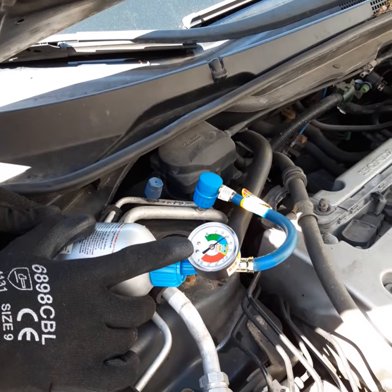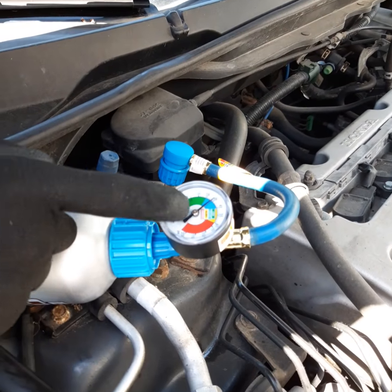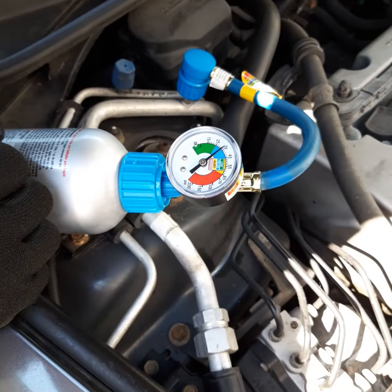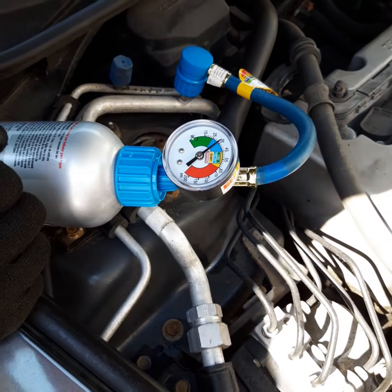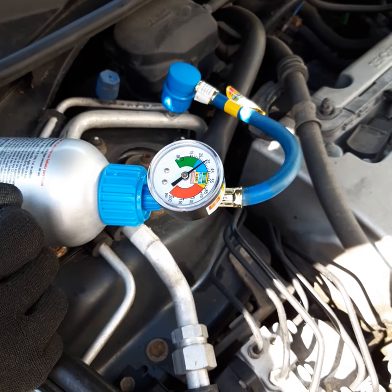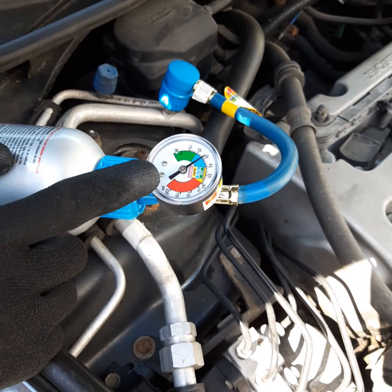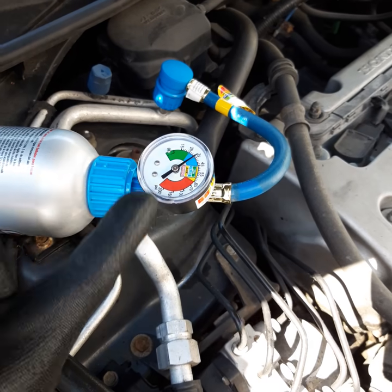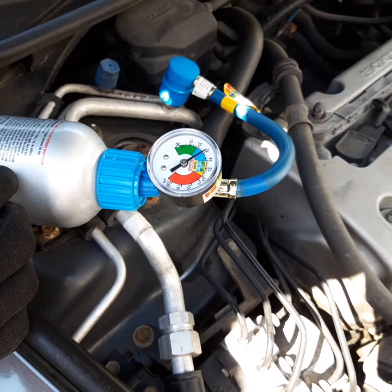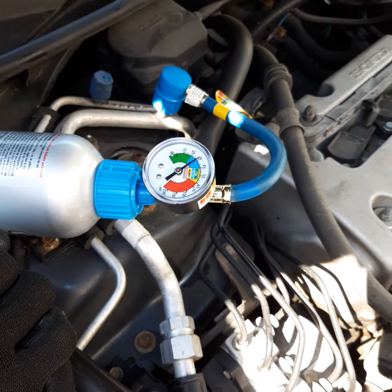By now I've added one and a half cans of refrigerant. You can see the gauge is now at the midpoint of the fill area. I already went and checked — the car is blowing cold air. For under 25 dollars I've recharged the system and will have cold air for the summer. If this car starts blowing hot air again, my best bet will be to take it to a mechanic, since it may not be cost-efficient to recharge over and over. Once I'm done, all I do is unhook from the port and put the lid back on. Thanks for watching — I hope this helped!